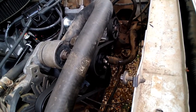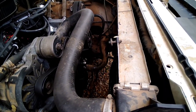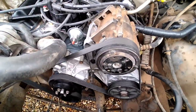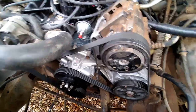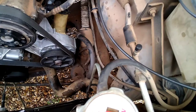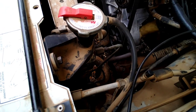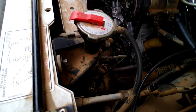I'm going to show you exactly what to do to get around that situation. I'm draining the radiator but it's just pure water — not getting any antifreeze on the ground. All you do is take your two radiator hoses off, take the transmission lines off on the driver side, take your overflow tank hose off, and then there are two 10-millimeter bolts on either side — pop them out and the radiator comes right out.